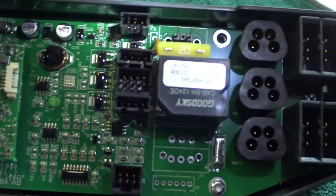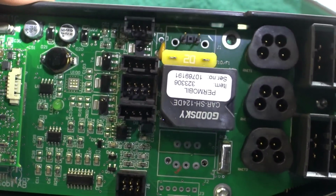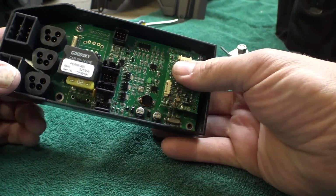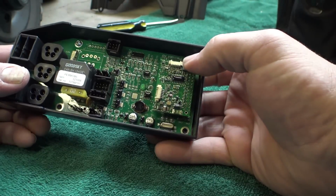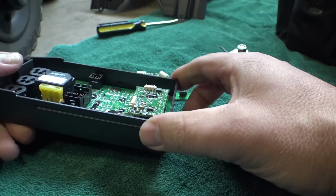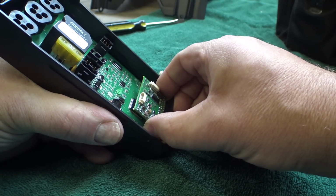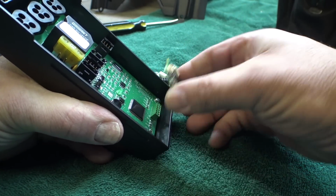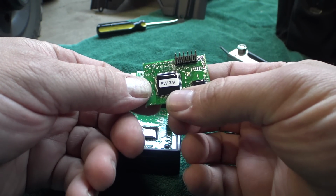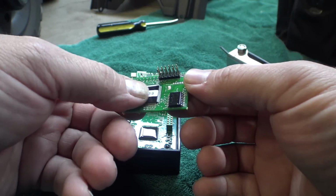Interesting. Yeah, because with the new animated lights and everything, it makes sense that we've got to have a little bit more logic in there. Huh, well there you go. It's the same underlying ICS module, although this one has conformal coating, as you can see all that shininess down there? It's really nice to see that. Previously, only this board had the conformal coating on it. This just sits on a row of pins that comes out. There's no reason you should ever remove this. But if you look at the back here, you can see we're running version 3.9 of the ICS. And yeah, completely conformally coated, which is great.